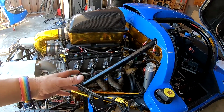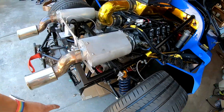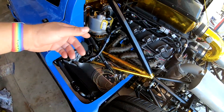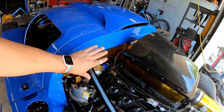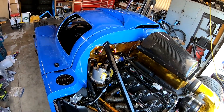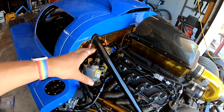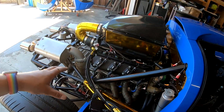The wrap itself still hasn't baked off yet — it's still cooking. There are little bits of harness that are just tied up here and there, things that still need to be terminated but just along for the ride for the moment — the circuits aren't in use. We've got the fire system in, all lines plumbed and nozzles set. This time I've better aimed the nozzles towards areas where the fire is most likely to be, like at the fuel tank and the headers.